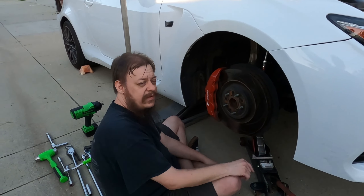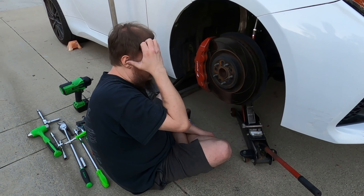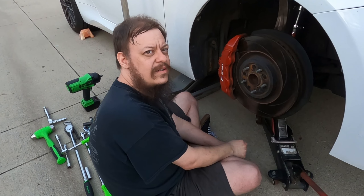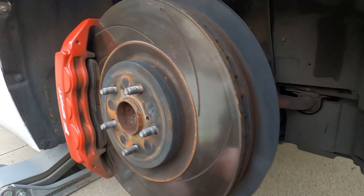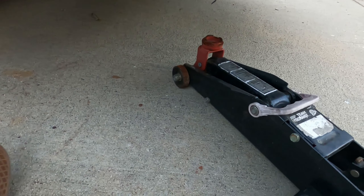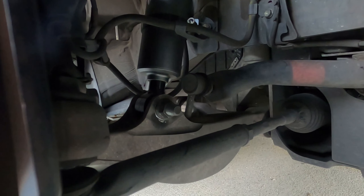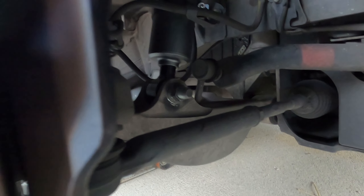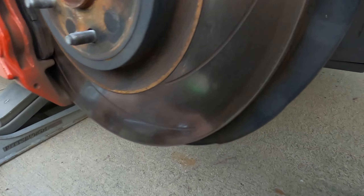It was a little more difficult than usual because the stock assembly is very long. To get the bottom mount in — especially for a first coilover install — you'll want a smaller jack that you can move easily. Put it under the control arm and jack it up until the bottom mount hole starts lining up. You may need to rotate the strut clockwise or counterclockwise and push it forward or backward. Then use a flathead screwdriver to finagle the hole alignment until the bolt lines up, pop it through, and tighten it down.